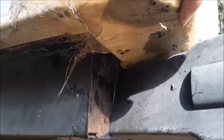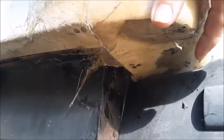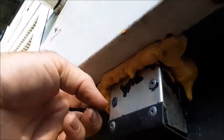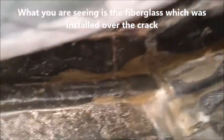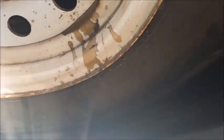At one point our camper got backed into something and it cracked the fiberglass plastic back panel, and there was actually a hole. So we mixed up some fiberglass and sealed it all back up. In the tire wells there was about a half-inch gap, and when you look up inside it's amazing what you'll find. On this camper there's actually a crack in the plastic up in the top of the ceiling of the tire well, and mice were actually getting in through that crack. These campers are not built with the most heavy-duty materials. We fiberglassed the whole ceiling of this tire well to seal it all up, including where the plastic meets the edges of the wood.